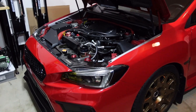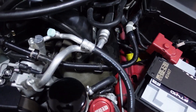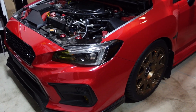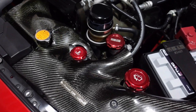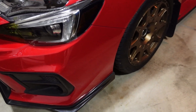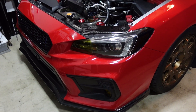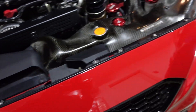I just got back home. I drove it for a few miles, did a couple errands, and so far it is running fine. It is still running a little lean but I think it's because I didn't reset the ECU, so I'm going to let it learn on its own. It felt good — I was reminded during my drive why I wanted to keep this car, it's just a lot of fun. One thing I noticed was a little rattling underneath, possibly a heat shield. The main thing is the turbo is in and functioning properly. Over the next hundred miles I'm going to drive carefully and inspect it.